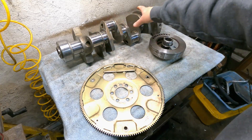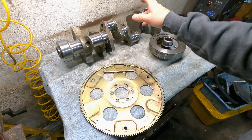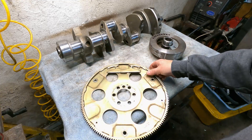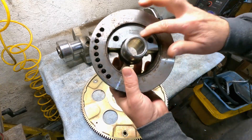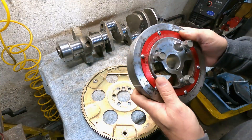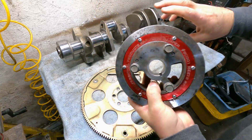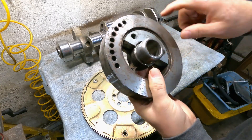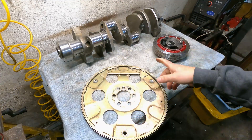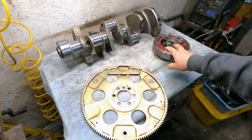I'm not sure how to tell on the crankshaft itself whether it's just the way it's balanced or if they're totally cast and machined differently. But I do know that if it's externally balanced, you need to have that weight on the flex plate and on the harmonic balancer. Harmonic balancers come in different designs too. I think the factory one has the weight just cast in with a machined difference on the external side, but this one has the weight internally and it's also machined for that area there.